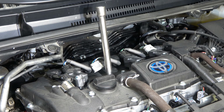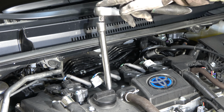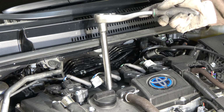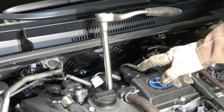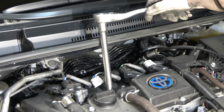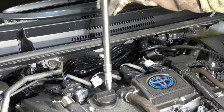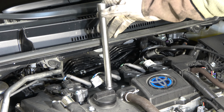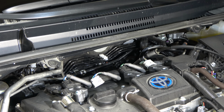And now it stops. It stops in here, and then I can fasten and tighten the spark plug with about 10-20 Newton meters force in that way. Do not overtighten, because if we break the spark plug, then we have a really big issue. And now it is in position, excellent. And then I carefully lift these things down. And remember that if your socket is in this area, then you need big pliers. But in my case, everything went fine.